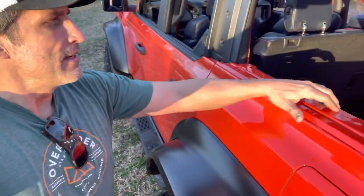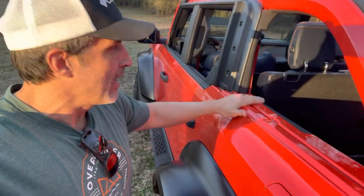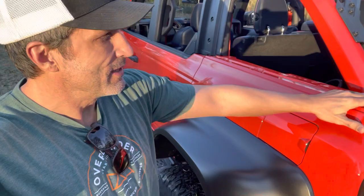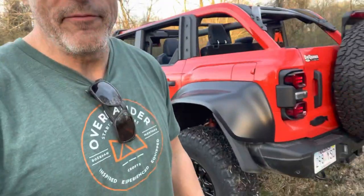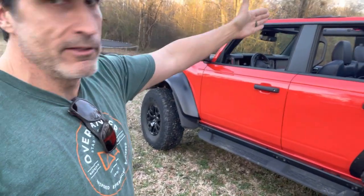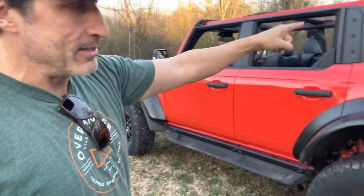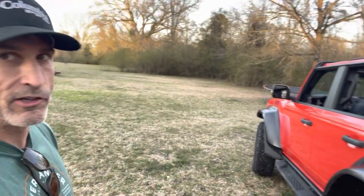It looks really cool with the top off — not too terribly hard of a task to do. It's got a couple of locating tabs which sit down inside here, and once you're free of that it's pretty easy from there. The Raptor steps are super easy to take on and off and you can do that without any help whatsoever — takes like five minutes. Both the front two panels and the middle long one are a one-person job. For the back one, have a plan in place and a friend, or just be prepared to think quick, because it's a long way to the ground and if you drop that on a corner it is very possible you could break the corner of your hardtop.